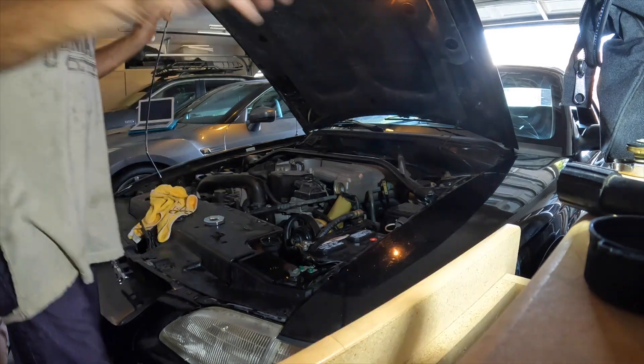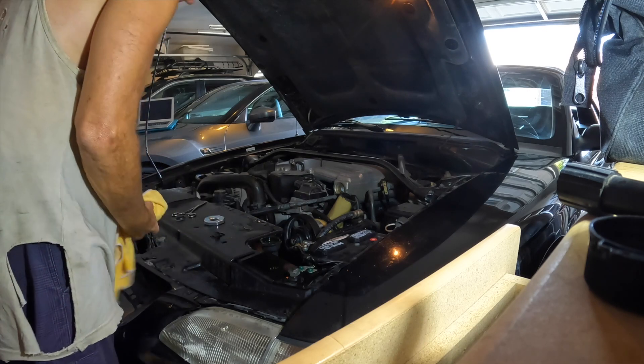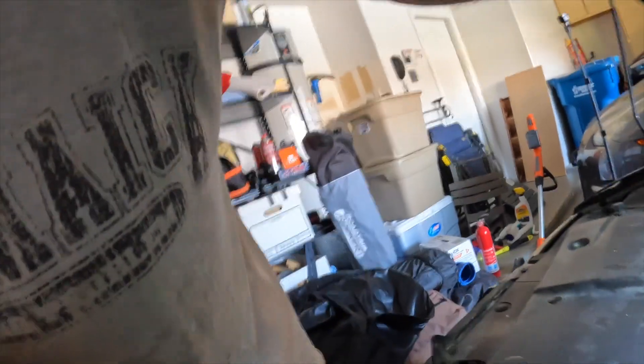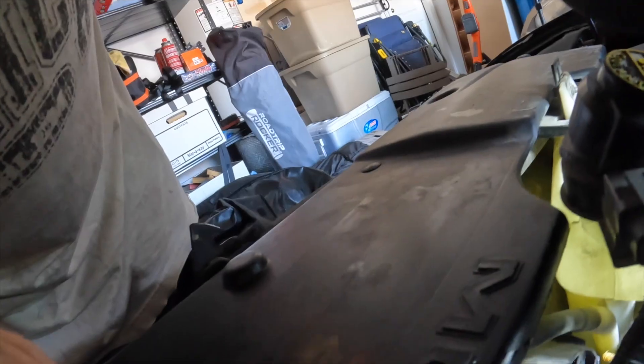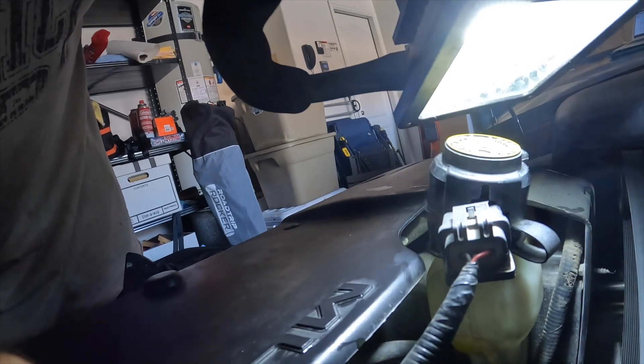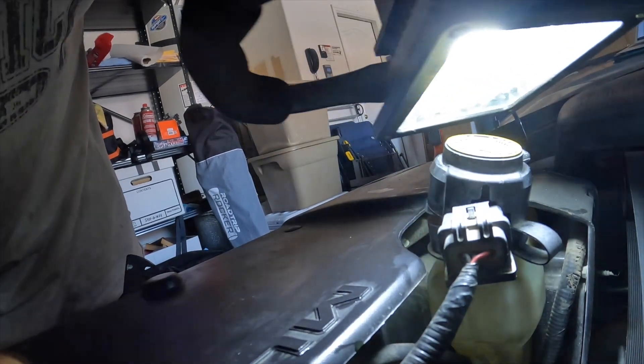The radiator cap is back on and I think we can take it for a little spin. The reservoir tank on the radiator - they say it's not supposed to be filled more than 30 percent, but there's a fill line on there. I think it's meant to be filled cold, so I'm gonna drive it around, let it cool down, then fill it up to the cold line. It's been about a month since I flushed the cooling system on my 1994 Mustang GT and I've got to say everything is working great. The car used to run a little hot but now it runs really cool. I'll put a link to the burping funnel in the description - this funnel and procedure should work on most cars.